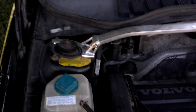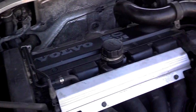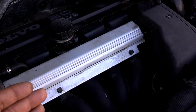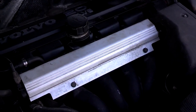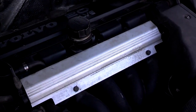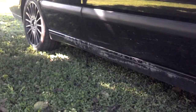So now I've got all the moisture or water coming out of my fuel tank. Now I've flushed the lines up to the fuel injector, made sure all of the water or moisture was through my fuel line up to the injectors. Then I would feel comfortable that there was no more water and fuel in there. I'm not cranking the car, I'm running the fuel pump, pumping this gas out. The absolute next thing I would do is replace my fuel filter, wherever that is, replace the fuel filter.